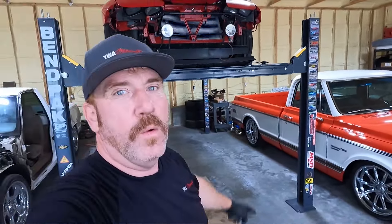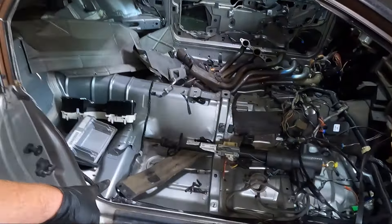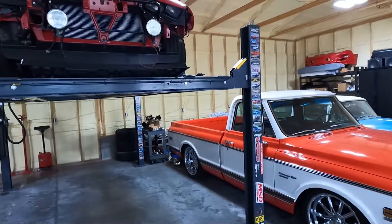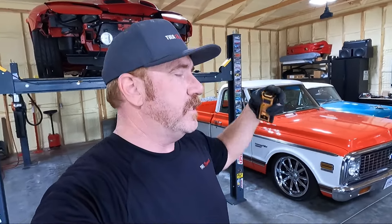The plan now has changed — I was originally going to do a chassis mounted torque arm that mounts where that factory stamped piece of metal goes, but the more I read about it the more people say they get a little squirrely on the highway when you hit the brakes because it changes the center of gravity. So I think I'm going to put a trans relocation bracket in with a long torque arm instead — I think that would be more beneficial for street driving, which is the majority of what this thing's going to be doing. Once I get one of those, I can rig up the trans cooler mount and figure out how short I can cut the lines.